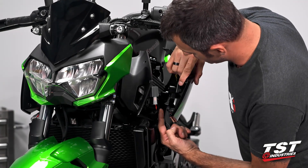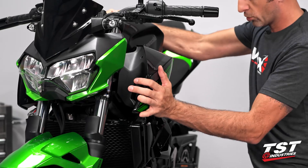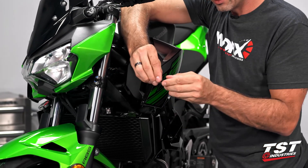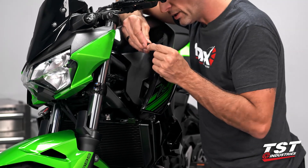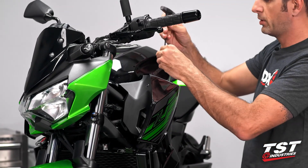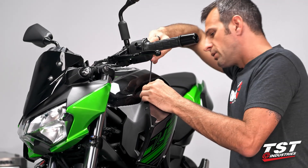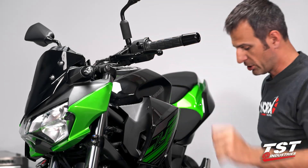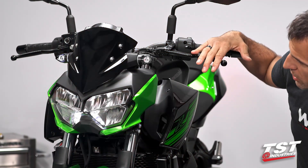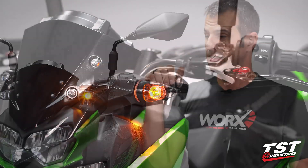Make sure all the friction fasteners that fit in the grommets end up back in their place. Push it all in toward the inboard side of the bike, then replace your rivet fasteners — they go in once reset, and you snap the center. Fasten the top with the 4mm Allen head screw, which goes into a rubber well nut, so it won't have a hard bottom — just get it down until you have friction. Signals are flashing at a nice comfortable rate; they're not hyperflashing anymore. It's a really nice upgrade that doesn't cost you a lot of time or money, and it's all plug and play.